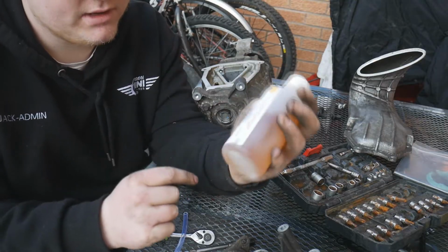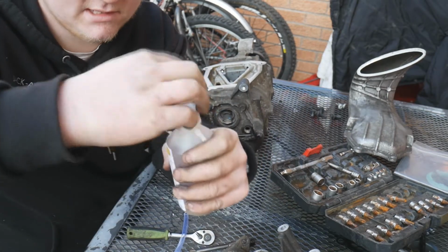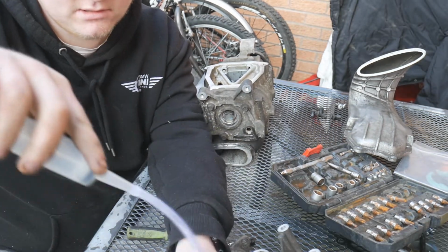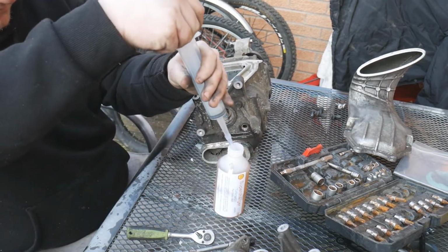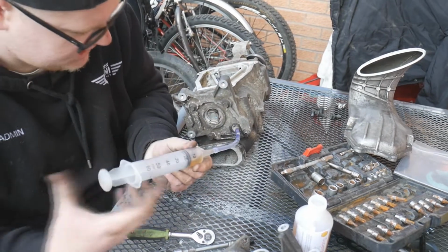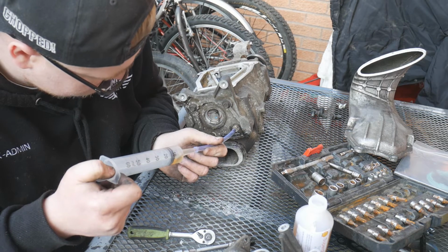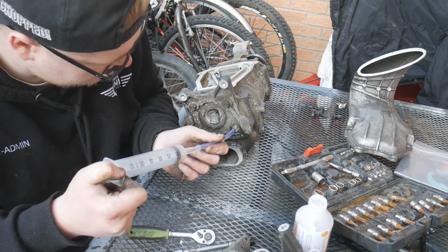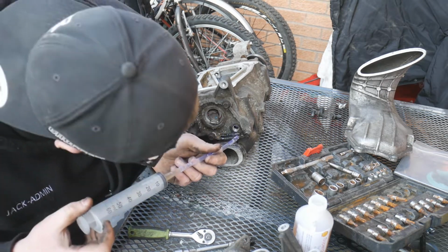So I'm going to grab my supercharger turbine oil for an Eaton M45, which is what these are. This is some Shell stuff. I'll leave a link to this in the description. And I'm going to use a provided syringe. Suck up a little bit into that. I'm going to place that in there. Squirt it in, pretty much until it comes out of the fill hole. Make sure you sit the supercharger flat so that you can get an accurate reading of the level of oil inside the supercharger.